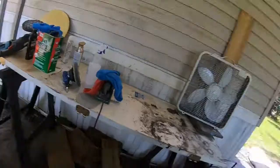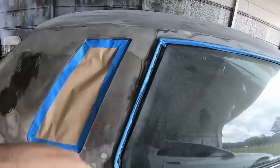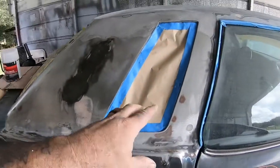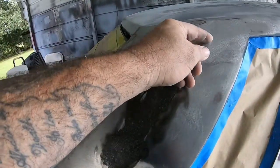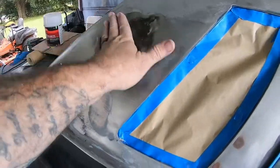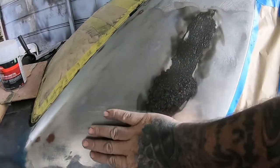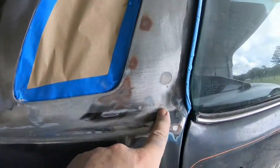I'm going to put up the stuff I was already using and get the new stuff out. Got it all sanded, taped off here, just have to finish the masking. I'm going to go ahead and do the body filler here - I want to get my prep all and get this cleaned up. I'm not going to make the same mistake I did last time trying to do little bits at a time. I'm just going to feather it from here to here and it'll level itself out.